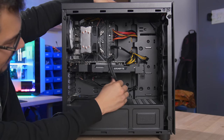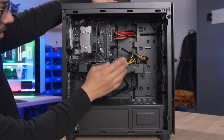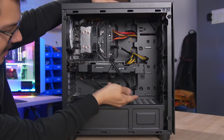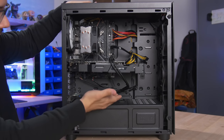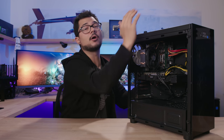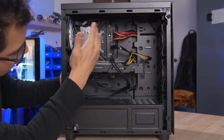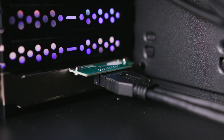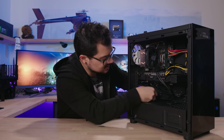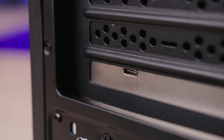There's a USB 3.0 header here — in the first video I thought it might've been custom sleeved extensions, but clearly I was wrong. Interestingly, they've routed it right over the video card. Proper cable routing would put this behind the motherboard tray. Also, I can now confirm the front panel USB ports are 2.0, because the only USB 3 connector on the motherboard goes to a rear expansion card — which is just a USB 3 adapter providing a Type-C USB 3.0 connection.